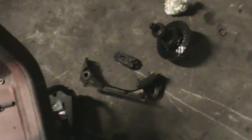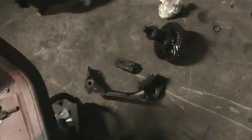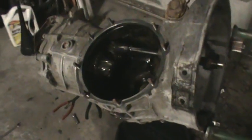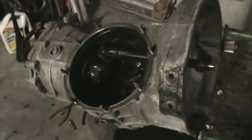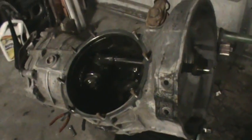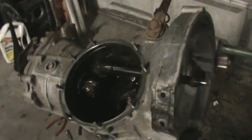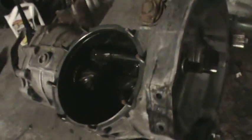We'll assemble it - the girdle is off there, one of the mounts broke loose. We'll put those mounts on, paint that mount piece, and reassemble. I'll check the backlash with the dial indicator before putting it back together to make sure it's not too noisy. Other than that, we'll be looking for a 3.88 or a freeway flyer box - one of the two.